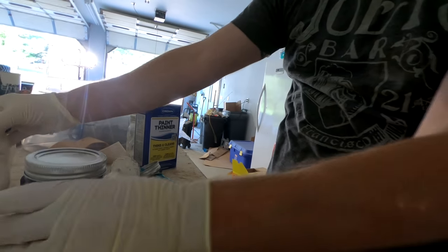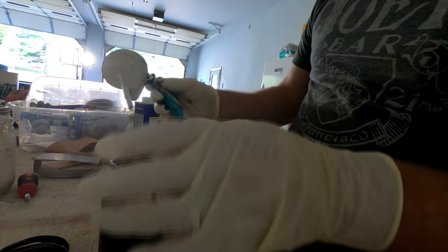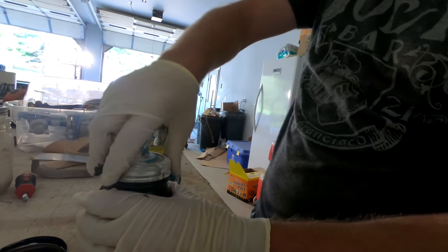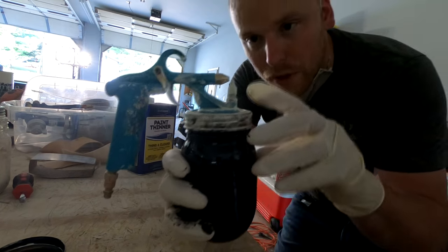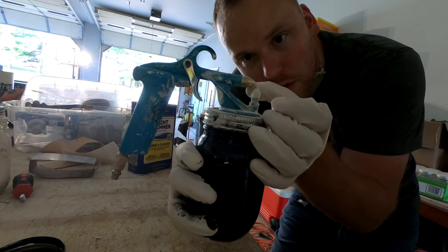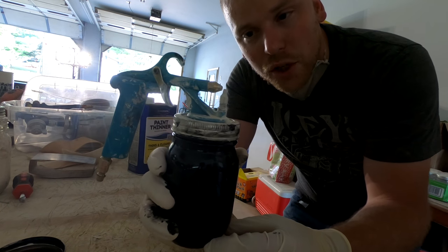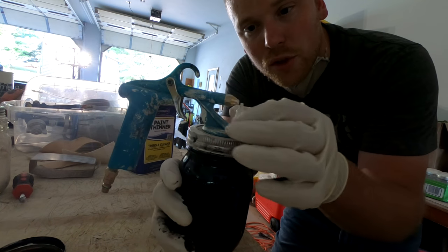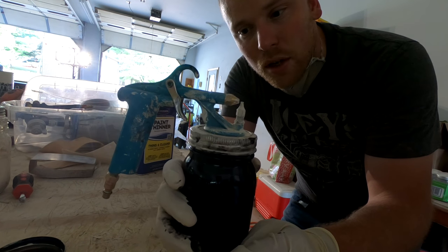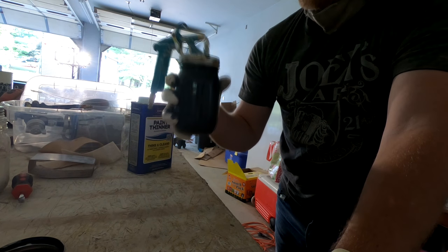I use mineral spirits when I'm storing the Critter — when I'm done using it I put it back in mineral spirits so it doesn't harden up on me. Then throw your Critter in there and screw it down. One thing I want to show you about the Critter: it has an adjustable tip, and you want that tip to be about midway across the blow hole to get a good stream. If it's applying too thick, screw the tip out a little bit — that'll give you more air and less volume. I'll wait a few more minutes for our Bondo to set up, then we'll sand and be ready to paint.